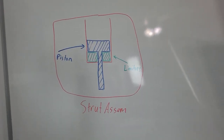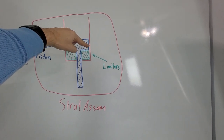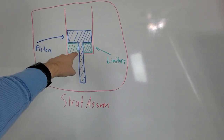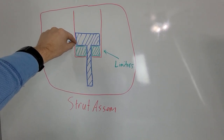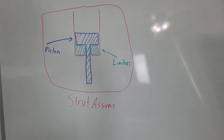There is another way you can do it as well, and that's with a suspension limiter. Here at the whiteboard: we can see the piston and cylinder. The cylinder from your strut assembly is drawn in red and the piston is drawn in blue — this would be inside the strut, and then you'd have the rod coming down to your lower control arm. What you would have to limit actual movement is this limiter. You place these limiters right inside of the suspension so that the piston can't go further down and occupy the space at the bottom of the cylinder. The limiter prevents it there, and your maximum distance is defined from the top of your strut down to this new position. This is how you limit the total amount of travel if you don't have any of the other options.